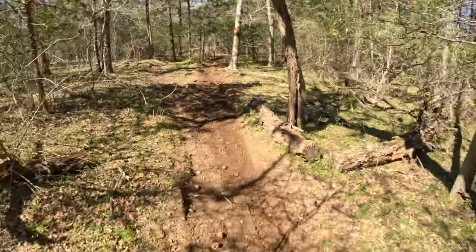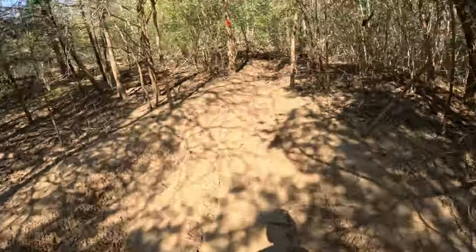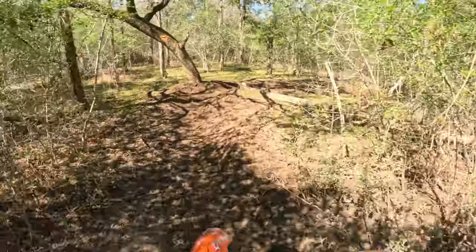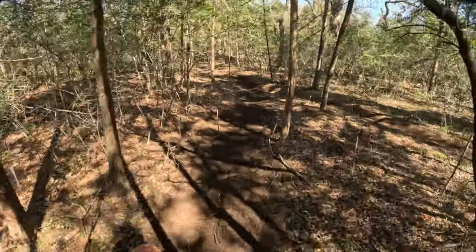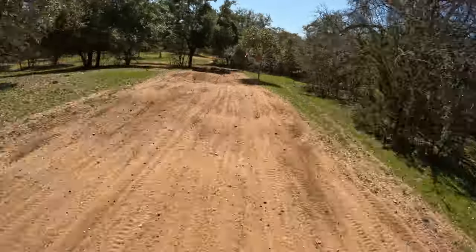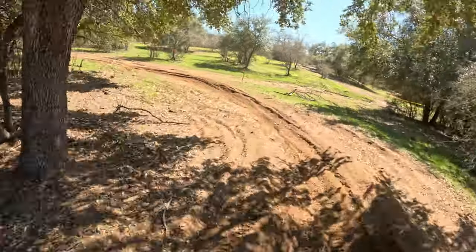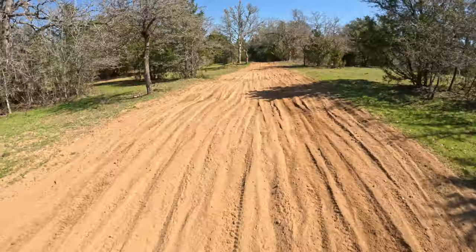I did try the SX dome that fits into the OEM head. It was a snug fit. There's a lot of stuff online that says it doesn't work, but I had zero issues getting it mounted and racing with it. I rode it really hard in the sand. I had no issues, but I did notice whenever I took the SX dome and the OEM head off of this bike to put in a TSP unit, that the inner O-ring was pretty hard for such a small amount of time.